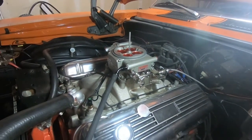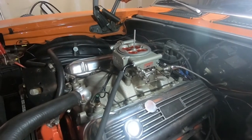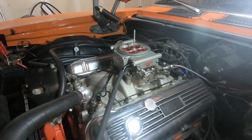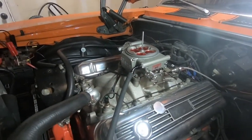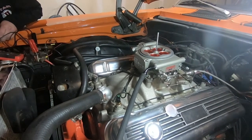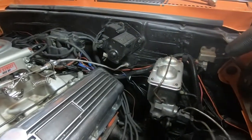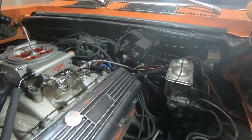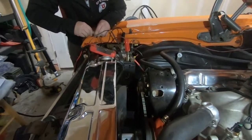Before the big first takeout we've got to cruise it and let the ECU learn, and after it learns - smoky burnout, right? So today what we've done is shorten the throttle cable, gone through all the lights, and now we're going to wire in a hidden ignition kill switch in the cab. We'll run the wire in about the same spot as before, route it up and around the back, and when we're done we'll wrap all the wires in some nice wire loom.